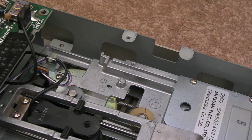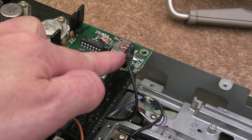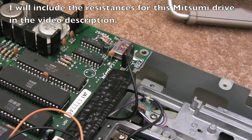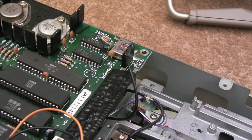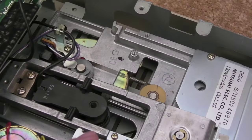After doing those two things I've got a lot of life out of this drive. Before, I was getting nothing at all — all of yesterday and the first couple of hours this morning, nothing. It's very interesting. If you've got a problem with one of these, I highly recommend checking the windings on the head: put your multimeter across the various contacts in resistance mode and make sure you haven't got open-circuit read or write heads. In my case they were fine right from the start.